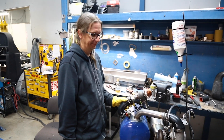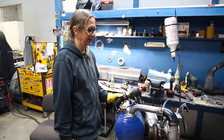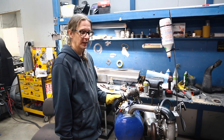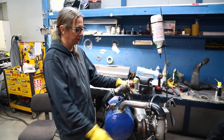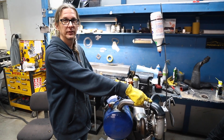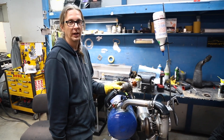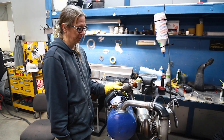I know what you're thinking — this looks like a big pile of shit, and I can't disagree. But last time we had this tube hooked directly to this tube, and the problem with that is the exhaust goes counter direction to the compressor, stalls it, and the turbo doesn't spin.